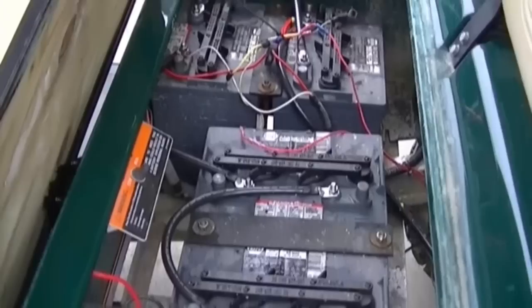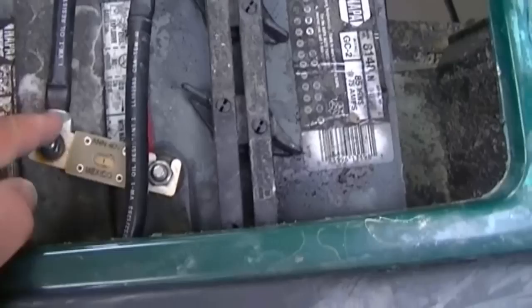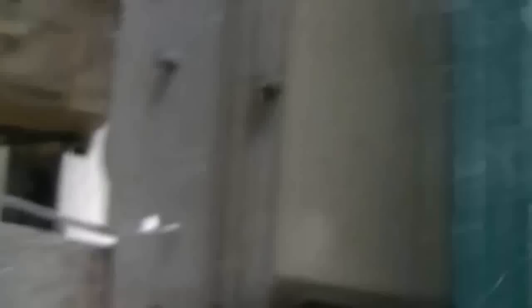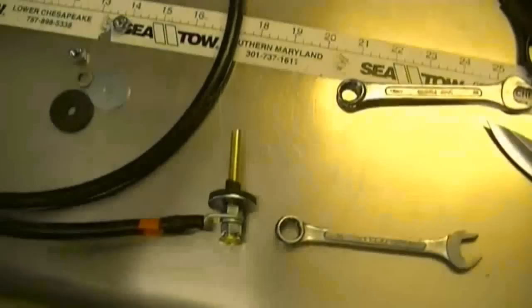When I wired up the cart, the cables that I bought — the set — did not come with instructions, and I missed a very important piece. Right there, that beige box is the onboard computer for the golf cart. The old ground wire ran from this terminal, and a fuse came with that speed controller, through that hole in that computer. I didn't know why that was there, so I just bypassed it and went right around it. The ground comes up through there and connects to the speed controller. Problem is, that's actually like an amp probe — that little hole through the inside. That computer senses the current when it's charging, so the computer can tell the charger when it's turned on and off. So by bypassing it, the cart won't charge. I've got to fix that, and I'm going to show you the fix right now.